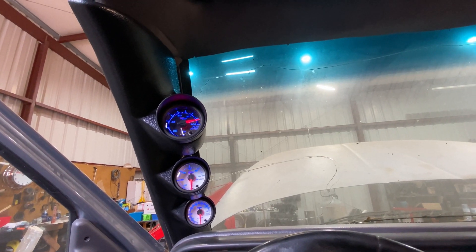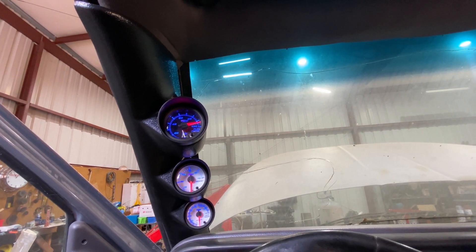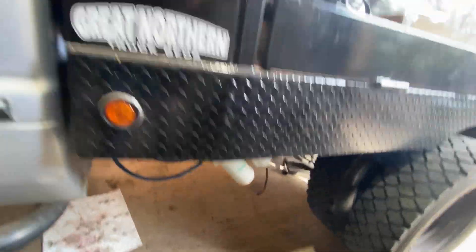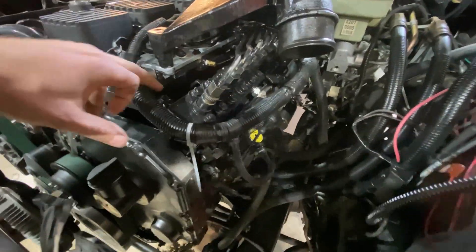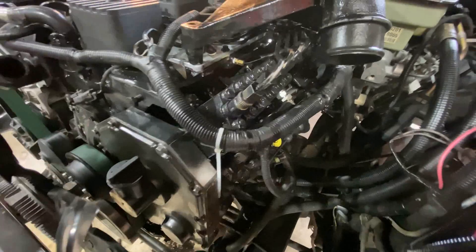Should be 55. Whoa — holy hell. Let's turn that down. I have the FASS down here — it's got a 55 spring on it. But up top I have an adjustable, because the pressure is going to be the same no matter what; it's just restricting the outflow, which is going to build it up more. That's kind of what the FASS does with the bigger spring. I'm going to back that off. That was just an expensive experiment, and I'm running with it.